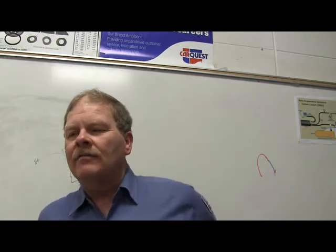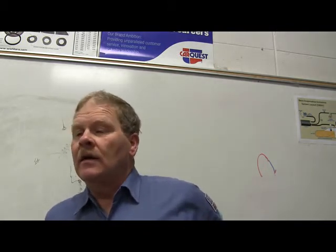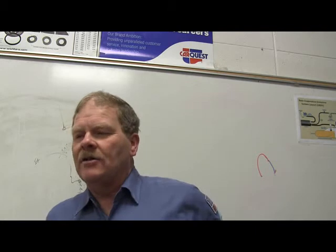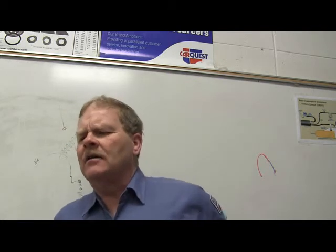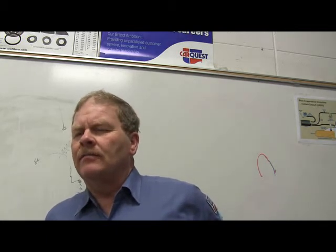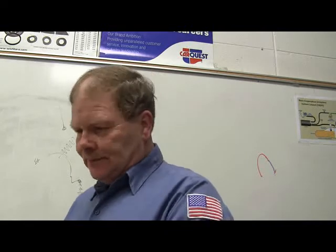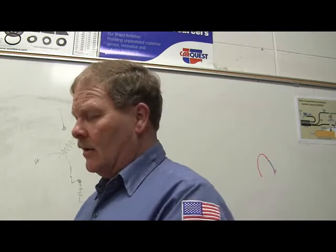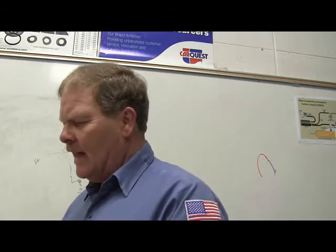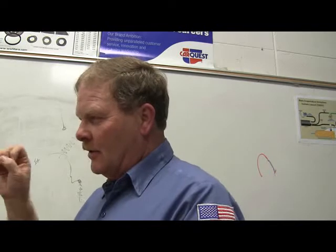Now, on the ones that have bimetal gauges, the older cars, and I'm telling you, these are the old cars, like pre-1970 and so on, very few of them in the 1970s had them still. But like I said, GM was pretty much the benchmark for this. Ford vehicles had bimetallic gauges, though, on their pickup trucks and a lot of their cars until about 1987, when they went with magnetic gauges. And I'll tell you about magnetic gauges in a minute, too. This instrument voltage regulator is a little device on the Ford cars. It had little connectors that almost looked like a 9-volt battery on them, and they would plug on the back of the cluster, and it would send a gentle pulse to those gauge wires all the time.